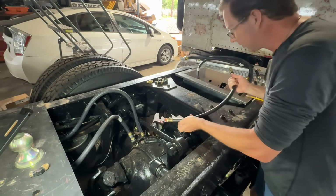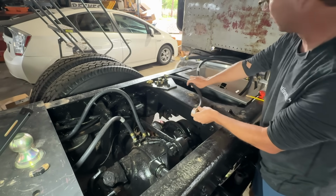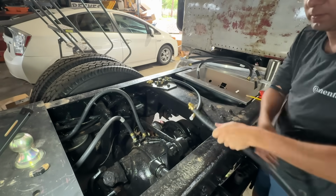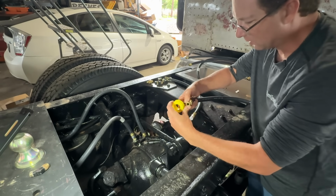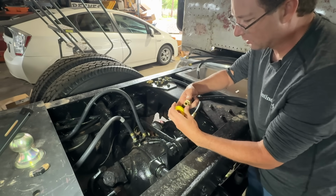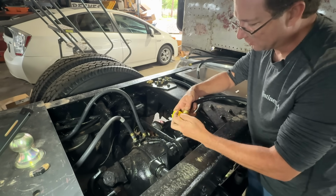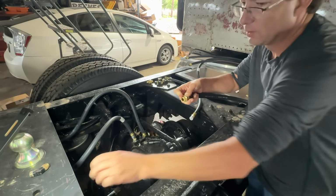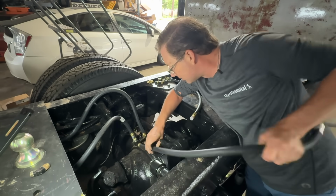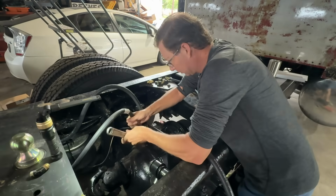Okay, so a small hose should go here, and that's not long enough. I probably have another one around here. Okay, that's our bigger diameter hose. Make sure we can get our Teflon tape on there. These are NPT, so pipe thread. That thread is actually a wedge, so it gets tighter. It expands, I guess you could say, the tighter you make it. So it's a wedge fit, and we want something to help it seal off. It's not like a compression fitting. Man, sometimes you just get lucky. That went in so smooth. Another crowfoot wrench around here somewhere.